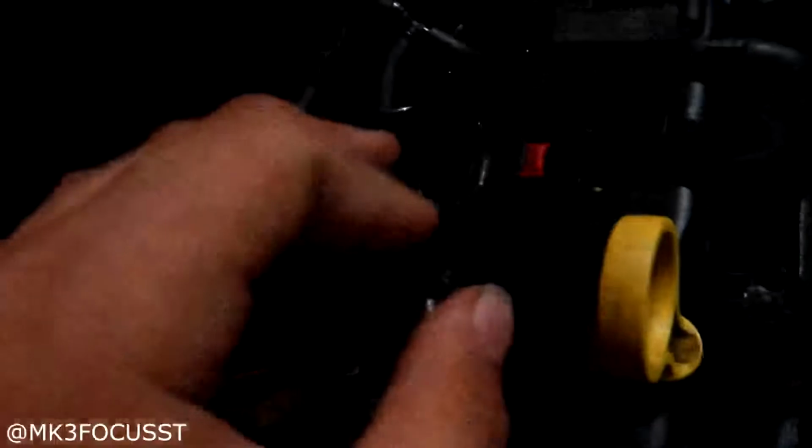Okay, so once you have this boost switch wired up, you can go to AutoZone, or I think the kit actually comes with a small piece of vacuum line. It's going to give you a plastic T. You're basically going to put it in between an accurate boost source, like it says in the plans. So you put the T in between the boost switch and your vacuum source. This was already a vacuum source, and then you just put a T and run it into your boost switch. This basically tells it that when you're at 10 pounds of boost, or whatever you set it at, spray the methanol, and all of this is connected.